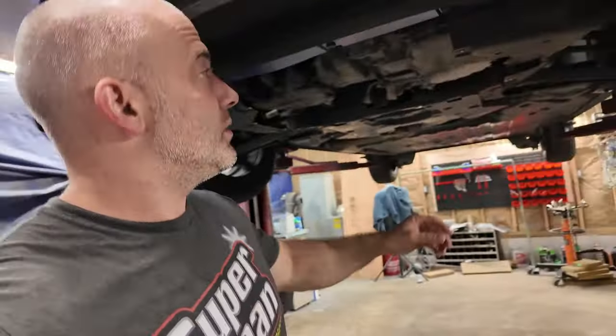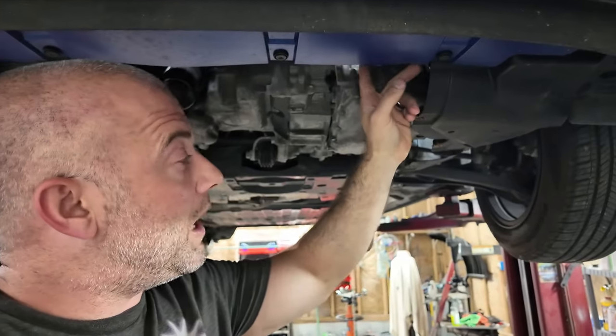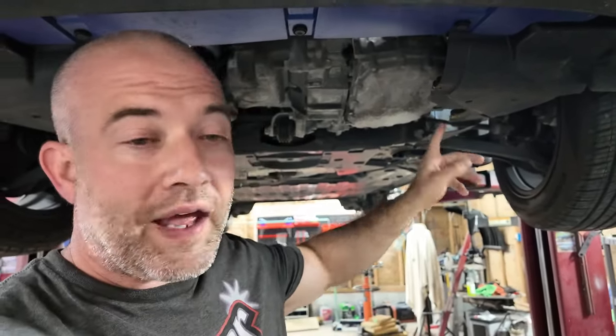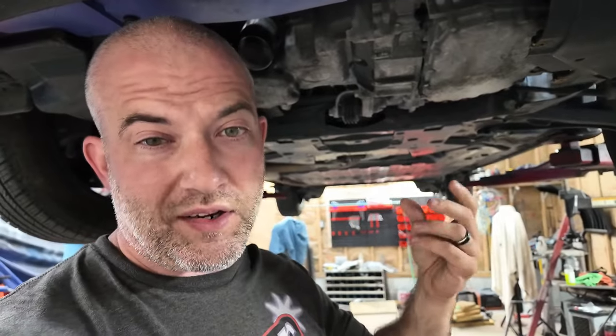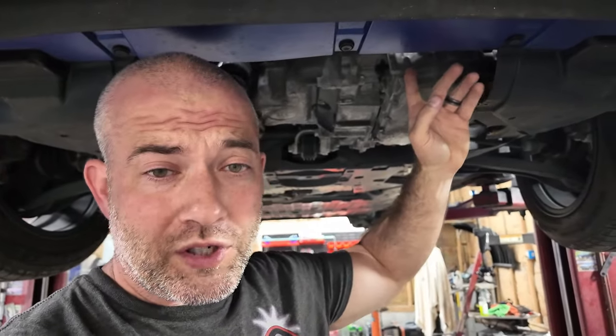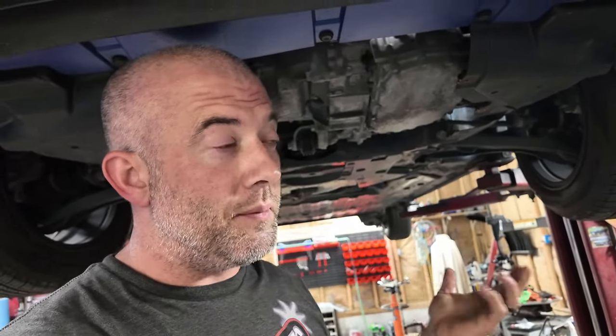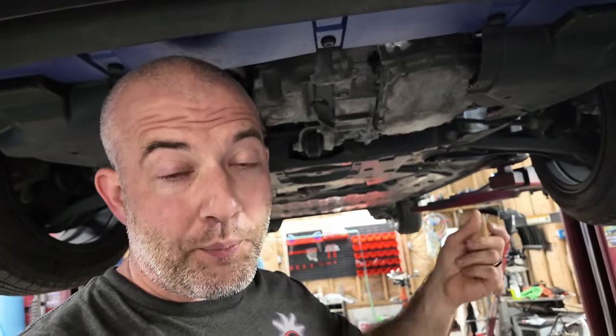All right, I watched like 4 or 5 different people do this, and it still leaves me with a lot of questions. Everybody that I've watched did this. Of course, you crack your level plug first, which they also called the fill plug, to make sure it's going to come loose. Then crack the drain, drain it, and clean the drain plug, because it has a magnet on it and there will be metal on it. Clean that, put it back in, and then they filled it through this hole until it ran out, put the plug in, then got in and shifted the gears, and most people were like, oh, we're done. One other guy pulled the plug again, checked it was low, and added a little bit more. I feel like that's right.